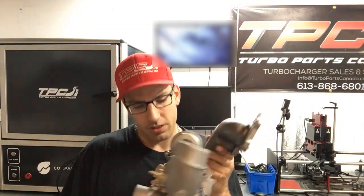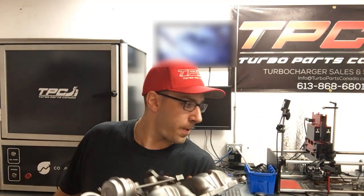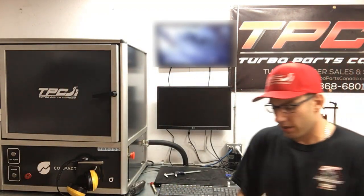This is the replacement — it's a cast manifold. I put it on the VSR balancer. It's a bit heavier but it doesn't crack. There's no point in buying another Evoque OEM manifold because as far as I'm concerned they should get recalled — they all fail, more than eighty percent of them.